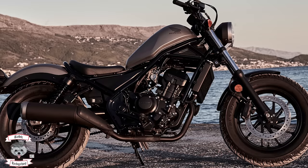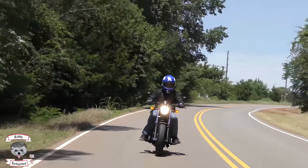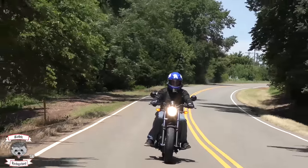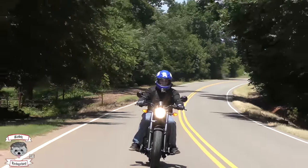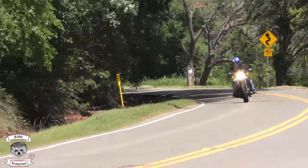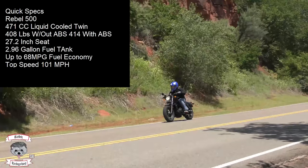Honda also included a bonus for those who are new, those who have played the game before, and those who want a bit more fun — and here it is: the Rebel 500. This motorcycle shares the exact same steel trellis frame, the same big tires with Indian Scout and bobber looks, the same 41mm front forks, the same coilovers on the rear, the same brakes — everything the 300 has — except this one packs a punch: a 471cc, 46 horsepower, weighing in at 408 pounds without ABS.